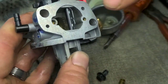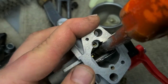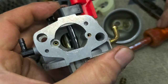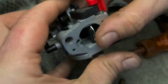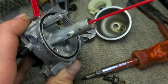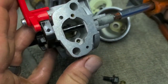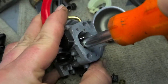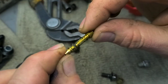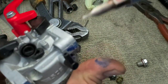The main jet looks clear, but down in the brass it's just packed. We'll take the emulsion tube out next — grab it and pry straight downward to get it out. This one is stubborn, so spray a little bit of Gum-Out carburetor cleaner in to break that bond, push it back in, then pry straight out again. There it comes — and it has ethanol residue all over it, all up and down. That's definitely not good.